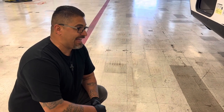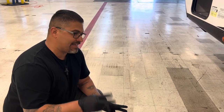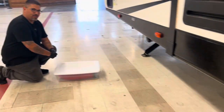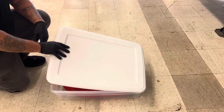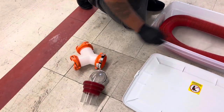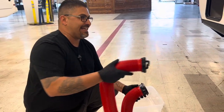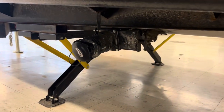Next, we're going to hook up your black and gray sewer hose as well as a galley hose. This model has two exits in the rear and one exit in the front. The front one is for the galley — the kitchen sink — and the rear one is for the bathroom shower and toilet. Your coach will come with a container where the sewer hose is stored. Inside you'll find a Y connector, an elbow, and a red sewer hose. We're going to hook up the sewer hose first to the front galley — it says gray tank two. Make sure the valve is closed before you open up this cap, and make sure you have proper gloves on before handling.